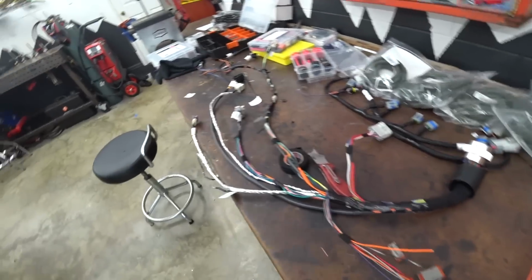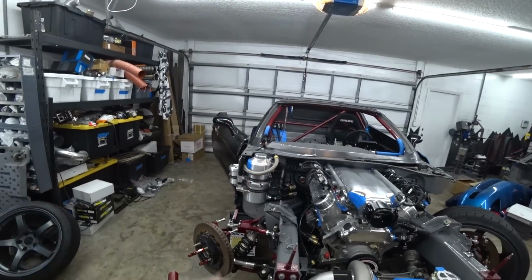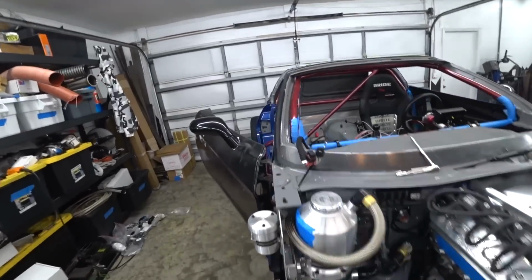It just would have been a little cleaner to do it on the inside, but then we'd have that extra connector if we pulled the harness over there. So again, same difference. Just knowing what I know now, it's probably the way I would have done it instead. But this was simpler, to keep all the engine stuff together and keep the main engine harness complete and not start splitting out of it down here.